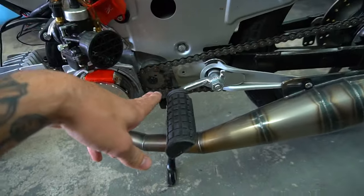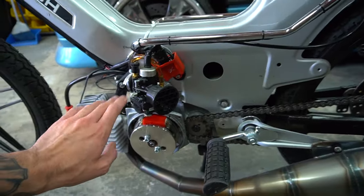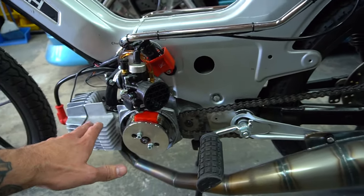This is the only pook I've ever ridden, but it feels good. Other setups I've seen have even less bottom end than I have, which means they're probably geared even higher for more top end. When I'm fully pinned at top end we're revving really high and probably only hitting 45-50 mph. I'm not sure how fast this 64.8cc kit goes on these single speed motors but I'd imagine it's in the 50s. I think I could up-gear it a bit on the sprocket — we've changed the sprocket multiple times, we ended up with a 13 tooth from a 16 tooth originally, and I have other sizes.